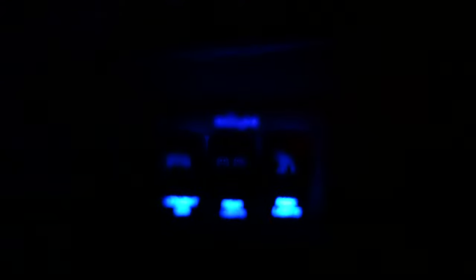I got that last screw in. Now I'm just going to clean all this up — and here we are, it is nighttime. Let's check these out. Oh, it's beautiful. What about when we flip it? Look at that. Well, there it is — another project done for the day. It works perfectly. I really like how the switch lights up at night, and I like how it lights up even more and even changes the angle so I can see which one is on when I look down. Something I didn't really plan on, but if anybody asks, I'm going to tell them I planned on it. We did have a little trouble with one of those wires — it was like the opposite effect of dimming: try to dim and it brightens, try to brighten and it dims. So remember, switch that over — it's the orange and gray one, not orange and brown.